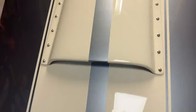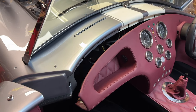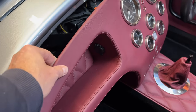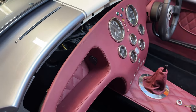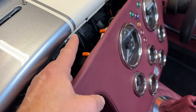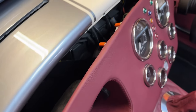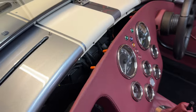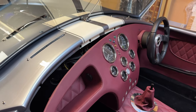Still lots to do - really need to get the windscreen out to fit the escutcheons and drill some holes. Need to get the dash out. The dash is quite tight - the padding from the front has been taken all the way around the top and it's added another four or five mil, so bear that in mind if you want to trim a bit more before sending it to the trimmers. A really good tip: you will scratch your paintwork trying to get the dash out because these studs will catch somewhere. Get some thread protector caps - a soft silicon type - or at least masking tape around the ends.